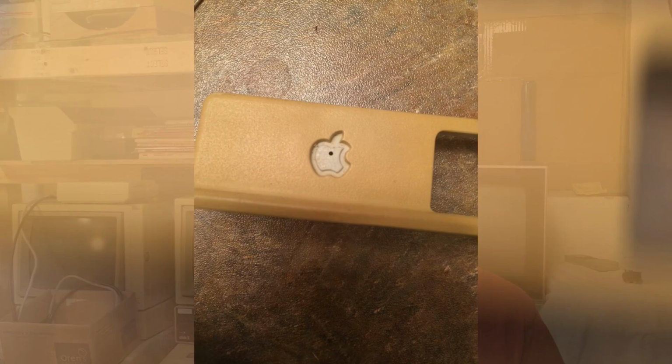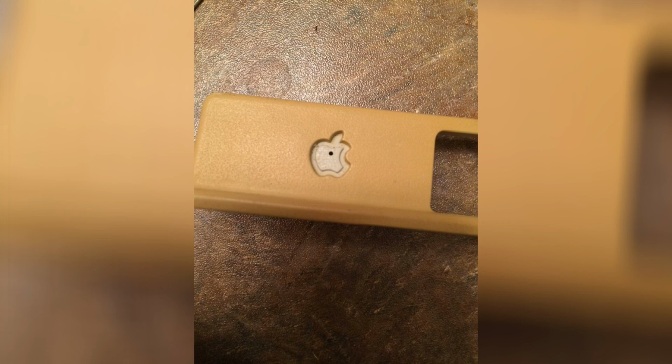Herbert Fung of the Apple II Enthusiast community on Facebook wrote to me. He said, "Hi Joe, just watched your Retr0Bright immersion video and wanted to add my 2 cents here." He says he always removes the Apple logo before treatment. As the logo is made of metal, it potentially can react to the hydrogen peroxide, and he'd rather not subject the paint to more UV than necessary. I agree with that. I just missed it. In my case, I didn't really think about it.